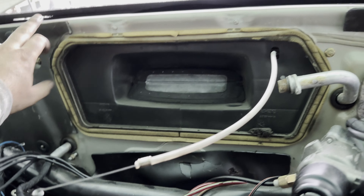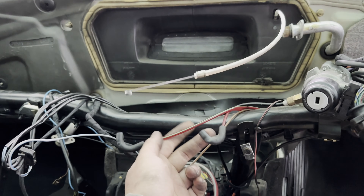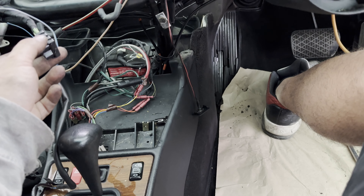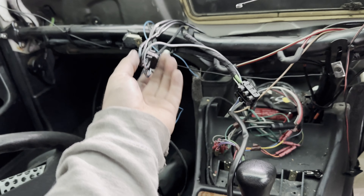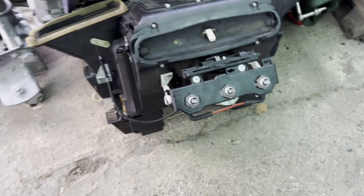The box is out. There's one nut here, one nut there — you just need to loosen the bottom ones on both sides. Obviously the pipes come out. This cable you need to disconnect from the slider switch. You have two vacuum lines — one for the right side, one for the left. You have your lights that connect on the back of the switches. There's a plug — I think it's for the speed — and there's a ground block on the side that you need to remove. Then it just slides up. I'll loosen the actual metal dash part to give myself a little more wiggle room.